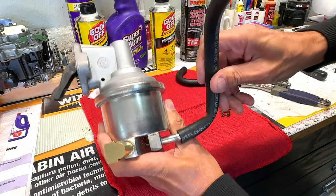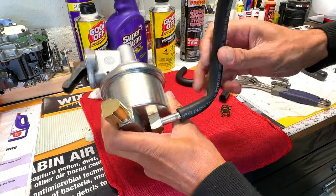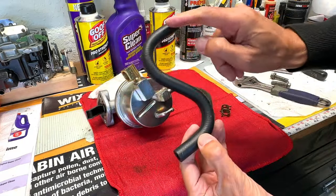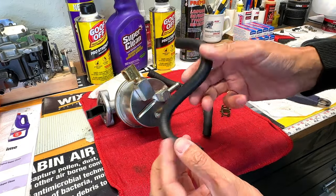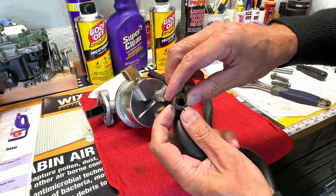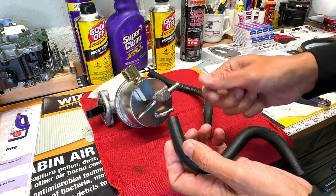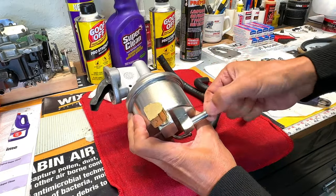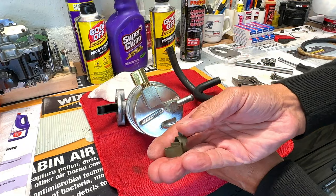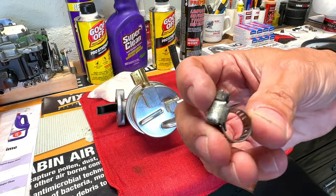Well, what's going to happen? This is going to happen. You're going to have a heck of a kink there, and that is never a good idea. So, like with the gaskets, get the right hose, and avoid a lot of problems. Usually, they come with the correct clamps. These kind of snap ring or whatever they're called. These clamps, they're great, and that's all you need. These have flares, so it's going to make a good connection. And all you need are these type of clamps. I usually stay away from these cheapo clamps.